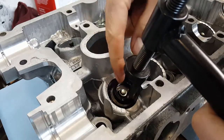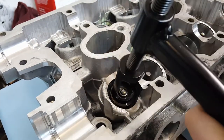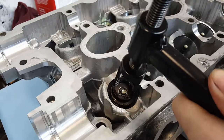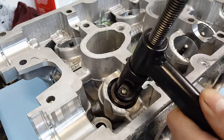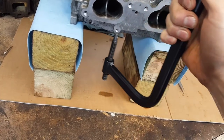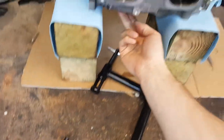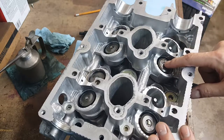Without the oil they would not stick like that. You don't want to compress it too much either, because the keepers will fall in too far and you'll have fun taking them out. Now unscrew the tool. I'm pushing the tool down on the spring so the bottom of the tool does not scratch the surface of the head — that's the risk: this side of the tool scratching the nice finished surface of the head.